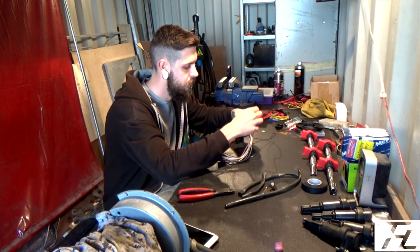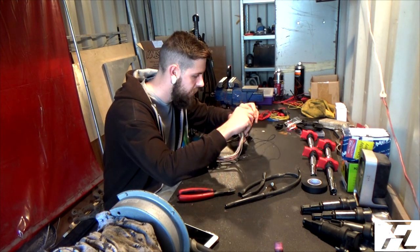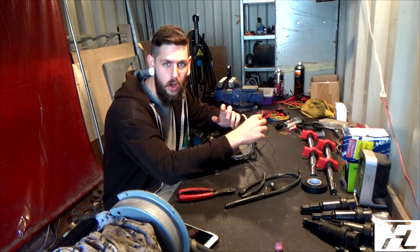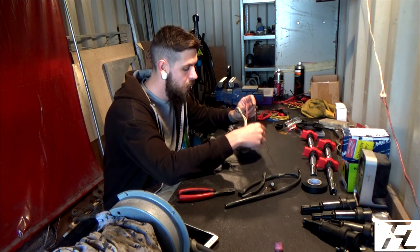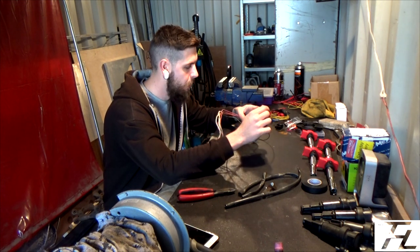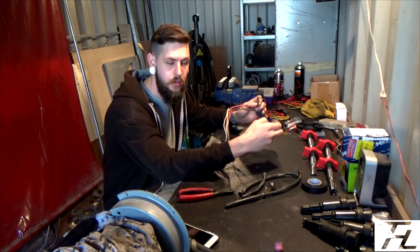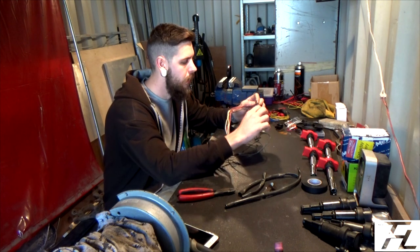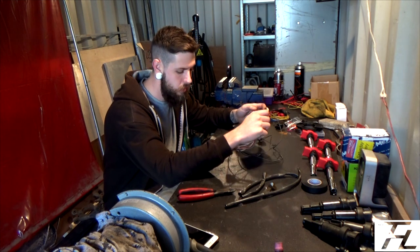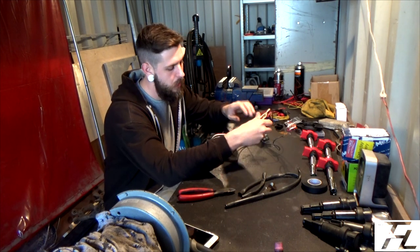All the red wires here: you've got a red with a green trace, red with a white trace, and a constant solid red. So they are your triggers for the 2, 3 and 4 coil packs. And then you've got the last one, which is split into 2 wires in the plug. This wire is the one that you would loop into for timing your SR. That's the one that comes from number 1 coil pack, and they've got some horrible little crimpy thing on here into 2 wires.